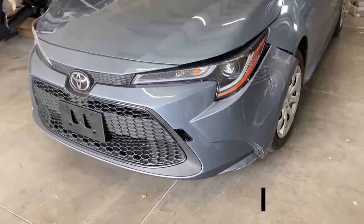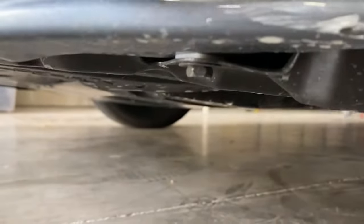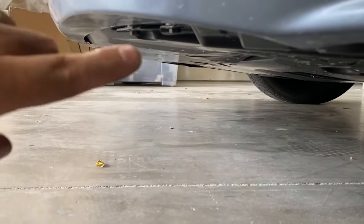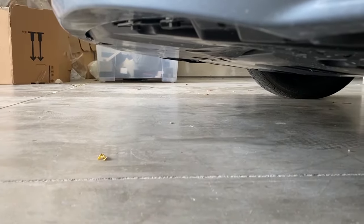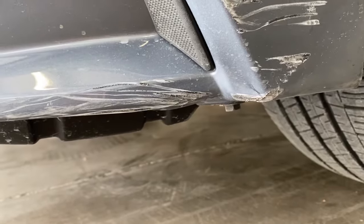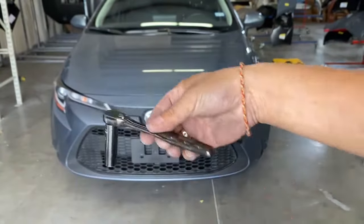So for this vehicle, we're gonna start off on the bottom right here, and you're gonna see some bolts. Right on the bottom on the edge, you're gonna see that 10-millimeter bolt, and it runs right on the bottom of the bumper. So just follow the bumper down and you'll see the 10-millimeter bolts. Each corner also has a 10-millimeter bolt, so let's go ahead and get those off. You're gonna need a 10-millimeter with a socket wrench.